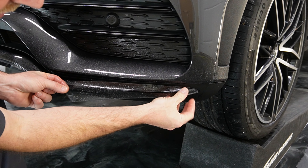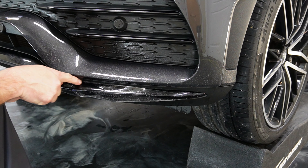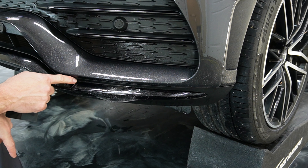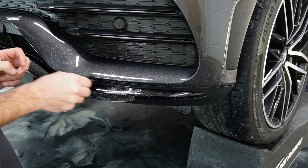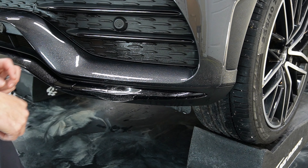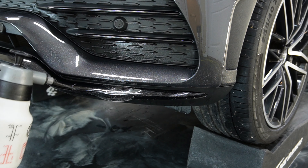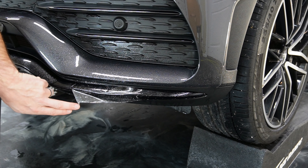Let's get this laid on here. I'm going to start right here in this corner, getting this edge lined up really well, laying it down nice and flat, getting that top edge in there really good. Once everything is nicely lined up, squeegee that out, get a little tack in there. We're going to need to do some stretching out this way, so we want this to stay tacked down and get this whole edge tacked down.